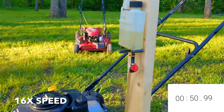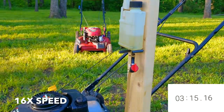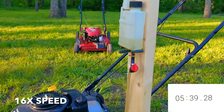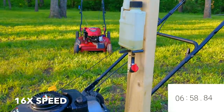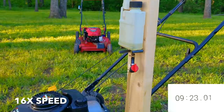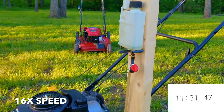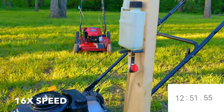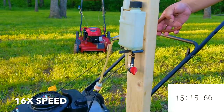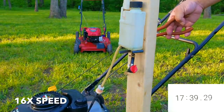One of the more popular comments I've gotten while doing this test is that I need to put a load on the engine while it's running, and I can't agree more — but when I ask people how to put a constant, repeatable load on the engine, they don't ever have a really good response. The only easy way I can think of would be to have several streams of water spraying under the mowing deck so the blades would hit the stream and apply constant load to the engine. I've also gotten good suggestions about testing the self-propelled system. One great idea was to tether the mower to a stake and let it run in a circle using the self-propel. I'm just trying to figure out how to attach the tether and add a safety switch to stop the mower if it comes loose. As you can see, I'm having to empty the fuel line of gasoline again because a low spot formed below the carb. I might consider making the fuel line a little shorter, but I really don't want to modify the test rig too much.